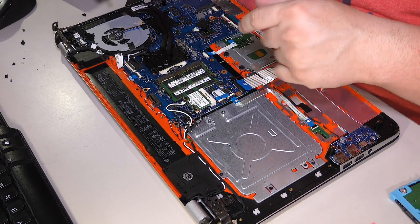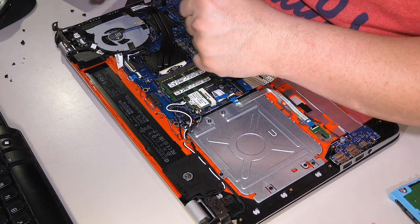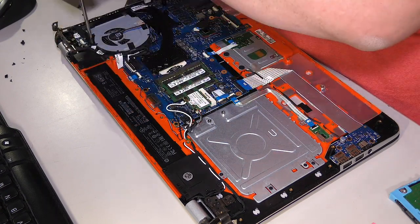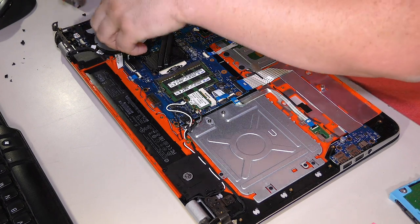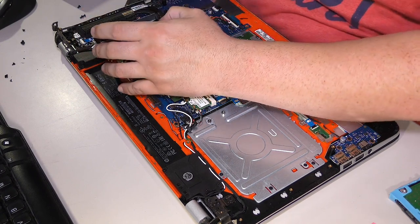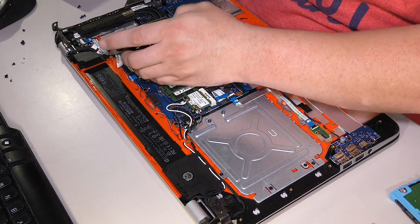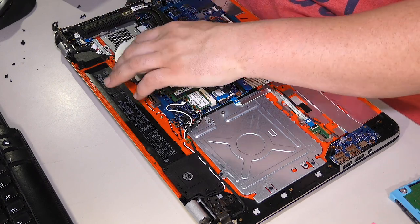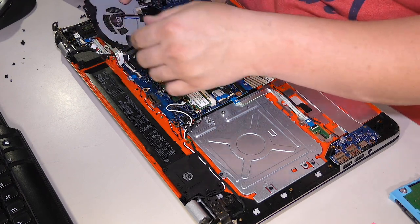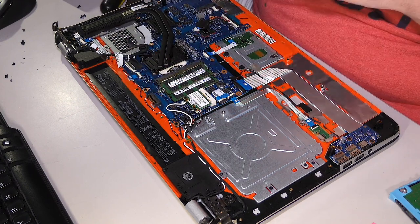So while we're in here looking at all this other stuff, before we get any epoxy out, maybe we check the CPU fan. See if maybe this fan is bad or if there's something clogging it. I don't really see any clogs. It looks fine. It seems to spin fairly decently. No, but I do feel a... seems like a bearing noise. Hang on. Let's blow it.